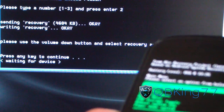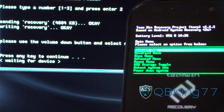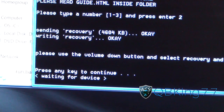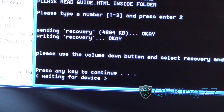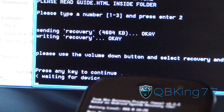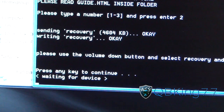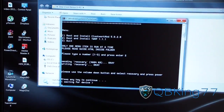I'm going to unplug it and plug it back in — hopefully it then recognizes it. It's still waiting for device, so I'm going to go ahead and show you how to do the rest manually. Your phone isn't rooted yet — it just has the custom recovery, whether it be ClockworkMod or TWRP. If it continues to wait, you can exit out of the script. Since you have your custom recovery, you're good to go — you can exit out of your one-click root script.